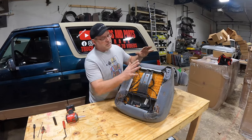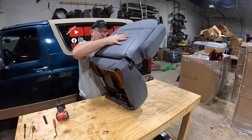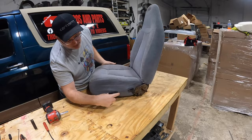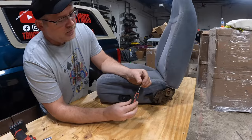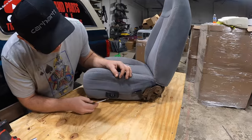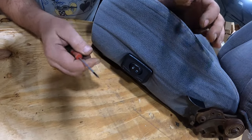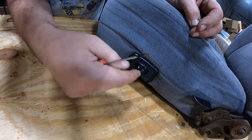What we've got now is the seat and the seat pan, but we still have to contend with the lumbar controls and remove the back of the seat. We're going to disassemble the lumbar controls. I use a very small flathead screwdriver. Inside there are two slots that you can pry the bottom of this panel out. Underneath there are two number two Phillips screws that will allow you to unscrew this and tuck it into the seat frame.